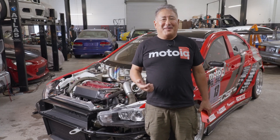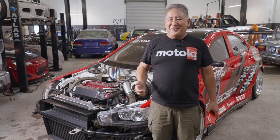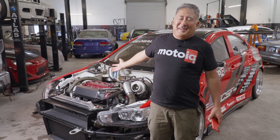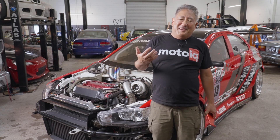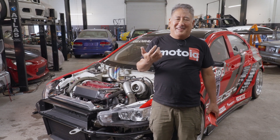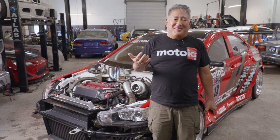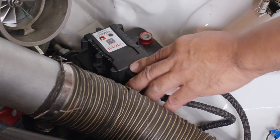Today we're going to talk about a product that's been a long time coming on the market — it brings turbo RPM reading to the consumer. For pro racing, like what we're doing with this time attack car, we've always monitored turbo speed for many different reasons, which we'll talk to in a little bit, but it's a critical parameter to keep track of. In the past, you had to have a standalone race-style ECU with data logging and wire your sensor up, which was beyond what a lot of consumers could do. But even if you're a casual consumer, it's still important to monitor turbo speed. That's been changed by Garrett with the introduction of their G-Smart Bluetooth Turbo Speed module.